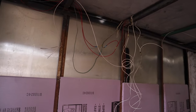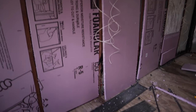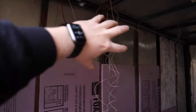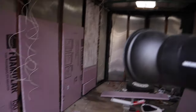Alrighty, so this is the inside of the trailer — got a lot of wires hanging and all that stuff, you guys saw me do some of that wiring. This wall is fully installed with insulation and then plywood. This wall is going to be more of a load wall — I think I'm gonna hang a couple things off it, so it'll have thicker wood. The other one will have thinner wood since I'm not hanging as much stuff — that's where we'll just be sitting. I've got the lower insulation ready, I'll put a piece of wood over it, then get the higher insulation and keep working my way around.